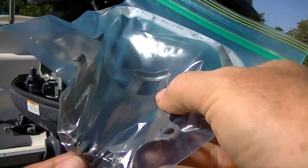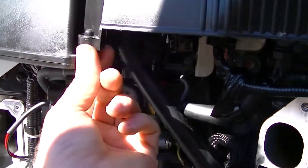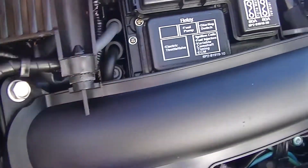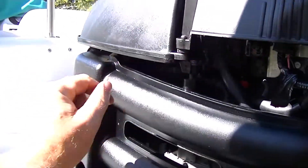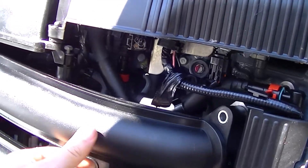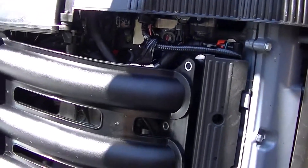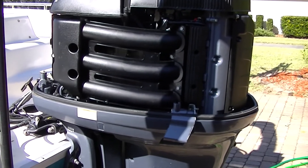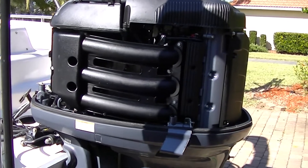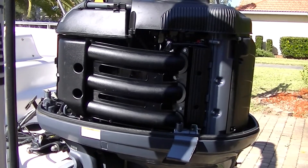We're getting ready to put things back together again, using my labeled bags and brackets. The back piece just slides down over these — they're not tight, so it slides right up and back down. Same thing on this side. I'm starting with the top bolts first just to hold it in place, and I'm not going to tighten them all the way at first. I'll do a crossing pattern because this is plastic going onto an aluminum head — you don't want to strip or crack anything. Tighten snug, not too tight. You don't want to over-tighten, strip threads, or crack plastic.